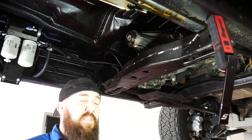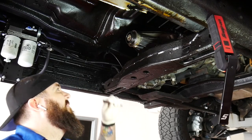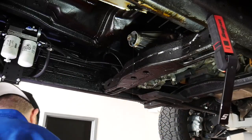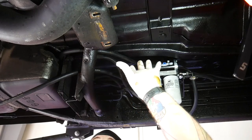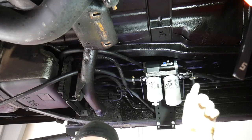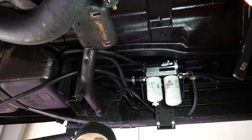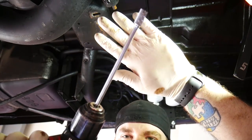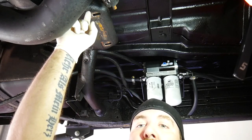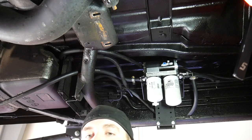I'm not going to go into too much detail on replacing the seal because I already did one video on this — up in the description you guys can see that one. So now what we've got to do right here where our carrier goes is we want to move it back a little bit more. Unfortunately with this driveshaft we just have to move it backwards — we've got plenty of room on our yoke up front for slip. These holes aren't hollowed out enough to move the carrier back, so we've got a carbide bit with a drill that's roughly the same diameter as the hole — we're just going to grind these down. I've already marked where they were, and we're going to move the holes back about an extra half to three-quarters of an inch. That'll give us plenty of room to move it back to where it needs to go.